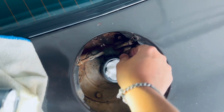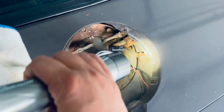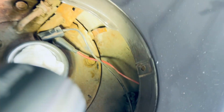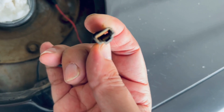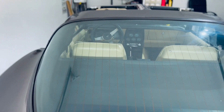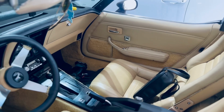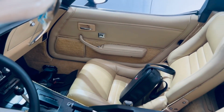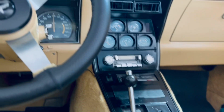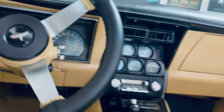So I managed to remove the ground. It's extremely rusted, not just the actual terminal. Let me see if I can get the camera to focus. But yeah, not just the terminal. I mean, this is definitely rusted. So my next step is going to be to try to turn the car on and see if the gas gauge goes down. If it does, then we know that the ground is the problem and we just have to clean it up, fix it up, and it'll be good to go. And if not, then, well, we'll have to wait for the next video.